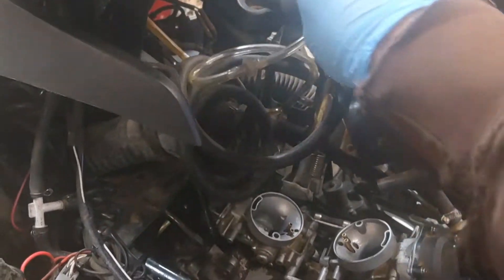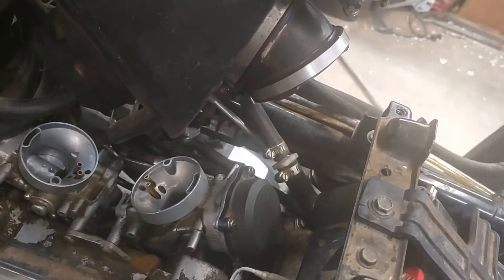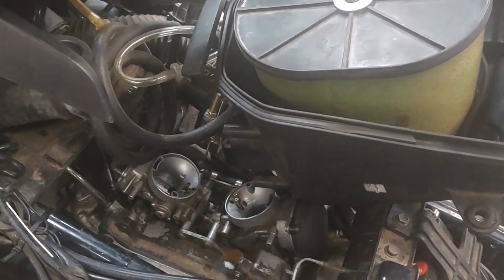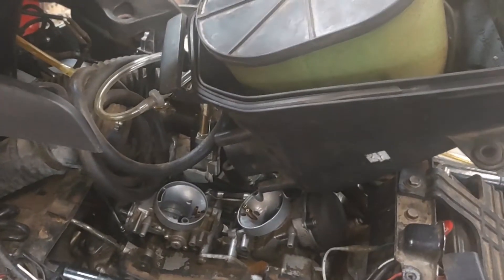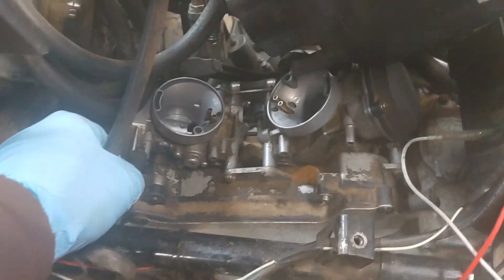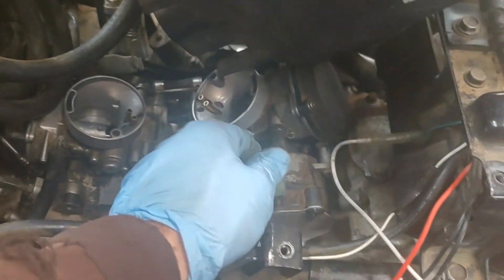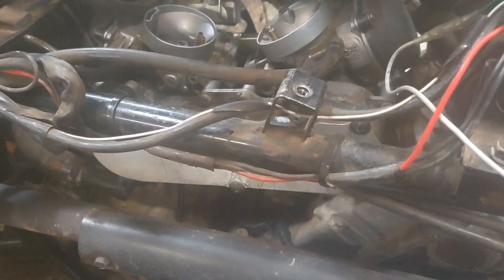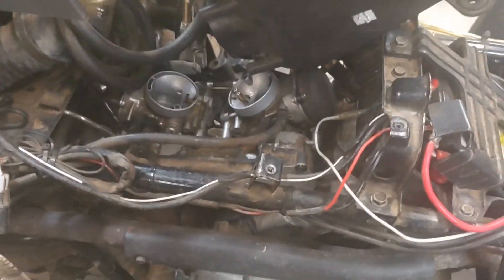Going to stick the airbox back on. The easiest thing to do is get the front boot started first and then slide the back boot on. Sometimes it can be very aggravating so use your patience there. One other thing I didn't cover - hook these vent lines back up to the carb, front and rear. Look around and make sure you don't have any gas leaks. I don't see anything leaking out now, so I think we should be good. I'll stick the airbox on there and we'll see how it runs.